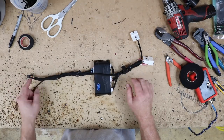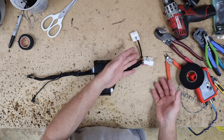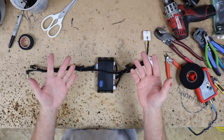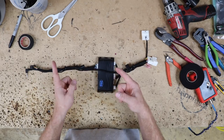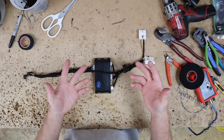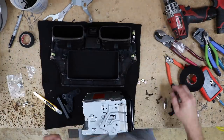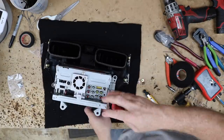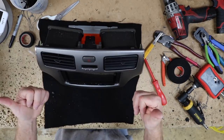Let's go ahead now and get everything hooked up to the aftermarket radio. So now we have the completed harness. We have our Pioneer plug on one end — this is the steering wheel control. We have our Toyotas on this end. It's a lot more manageable and it looks a lot nicer. That's up to you as far as how much heartache you want to go through to do all this. Now that this is done, we're going to get this into the car, plug this in, build the dash real quick, and then get this thing done. The radio's mounted in place, all set, ready to go.